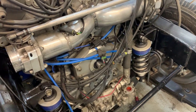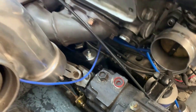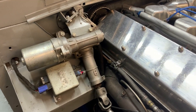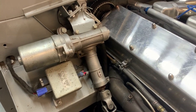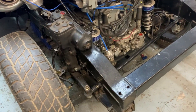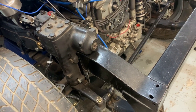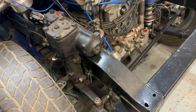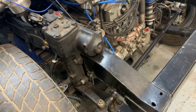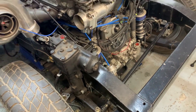Not running engine accessories means I wouldn't be able to have a power steering pump. So the power steering section, which is this piece here, isn't being used. I'm actually using an electric power steering device which is used on Vauxhall Corsas, and it has an electronic ECU with it. I'm just going to build it like it is for now, but this steering box is really, really heavy. Eventually that's going to be changed, or it's quite possible I just build a billet aluminium housing and do away with the hydraulic power assistance part of it and just put the internals into that. So I've got options there.